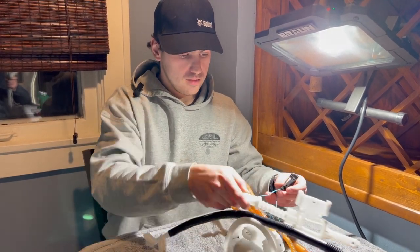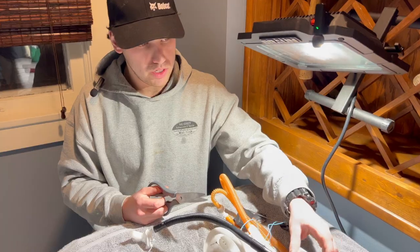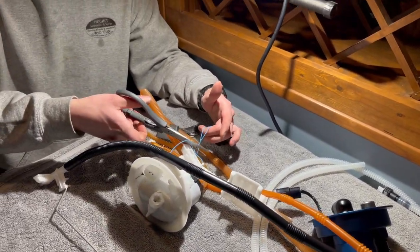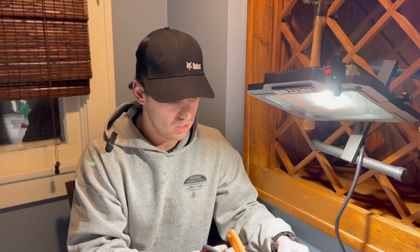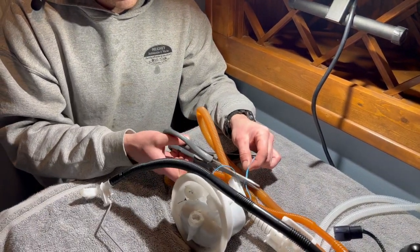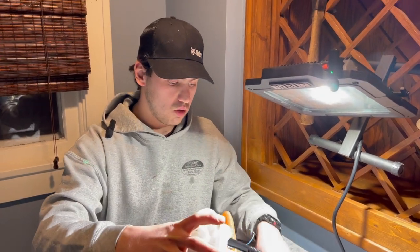They have a weird orientation for the wiring, but for the float system — which is going to mount onto the new regulator — the wiring orientation doesn't matter at all. All it does is send a resistance signal back to the car. Give yourself a good amount of wire in case you mess up and need to do it a second time. Cut around here and you have the float wires separate.